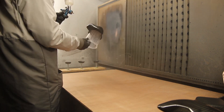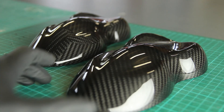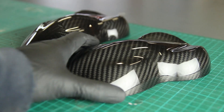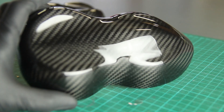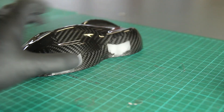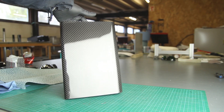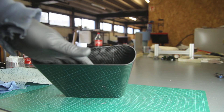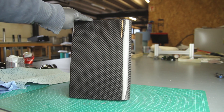This process is just for small parts or small defects. Otherwise you could use some epoxy as well for filling bridging gaps you have in your parts — I might make another video about that if there's interest. These parts shown are straight out of the spray gun with no sanding. If you sand and polish after, you get an even better finish without the slight orange peel.